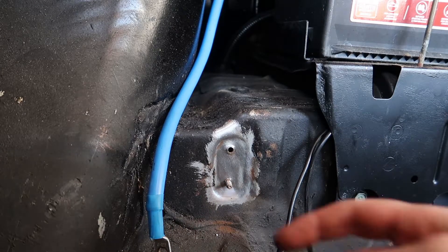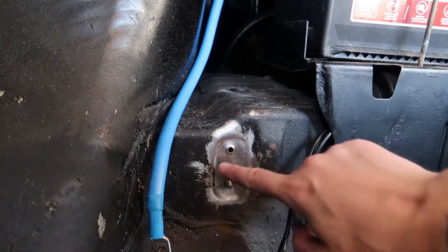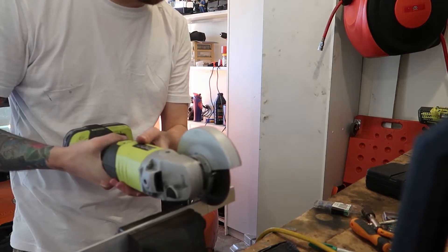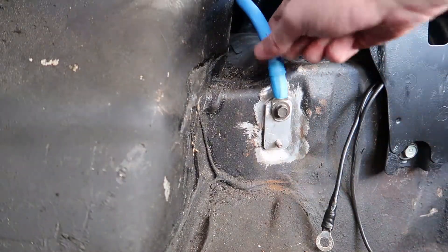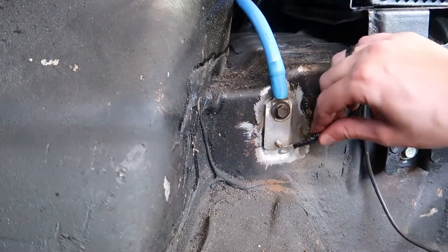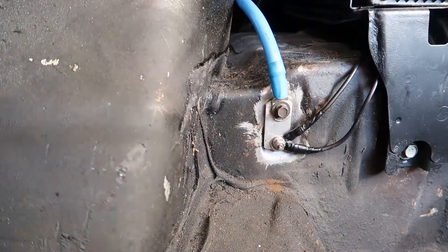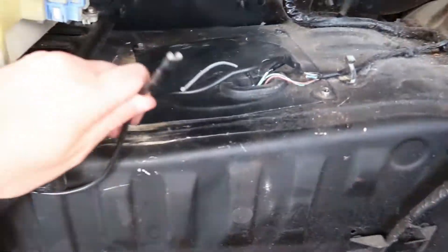We had a bit of a mishap - I was unscrewing the top piece and it snapped off, it was rusted. However, I managed to get another one off and cleaned it up and found a replacement screw. I'm going to make a plate to fit over it, drill two holes, and put a plate over so they're joined. That's bolted back in and it's really tight. Clipping the ring terminals on there - that's now grounded, and this wire will go to the relay.